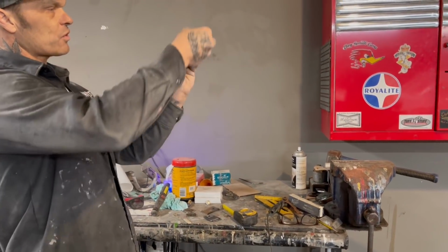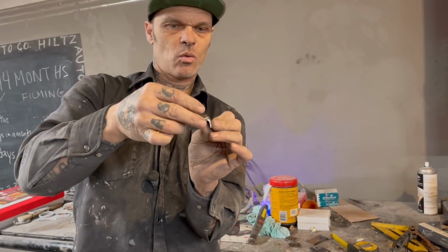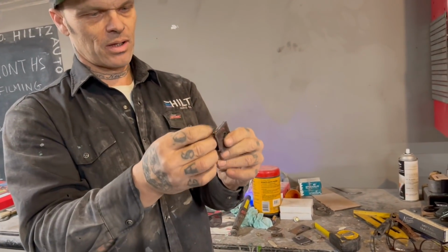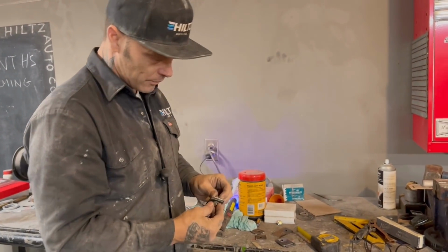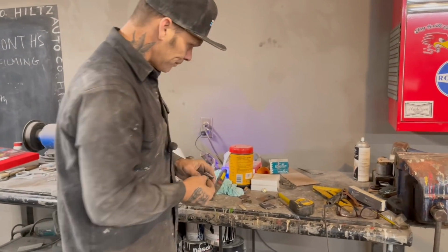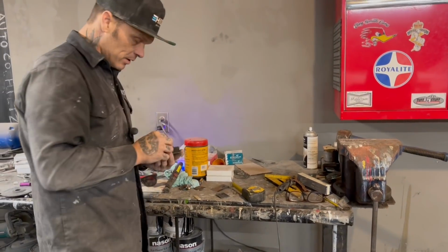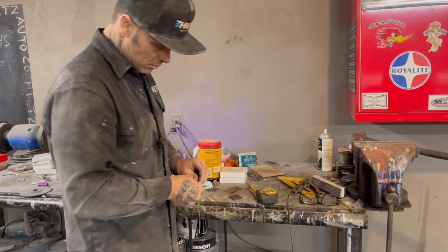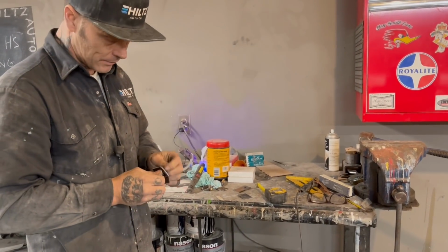That'll go on the fender skirt. That'll weld on the round rod of the fender skirt. This piece here will weld on the round rod of the fender. We'll just put that through there for now. It doesn't matter how. You know what I'm trying to do. And I need three of them. So we're doing one in the very back tail, so it brings it up nice and tight. We're going to do one up in the front where it begins. And then we'll do one halfway, and then we'll pin it at the top.